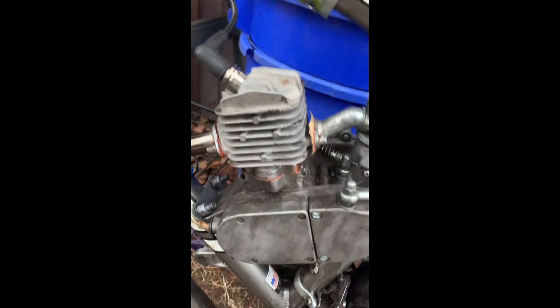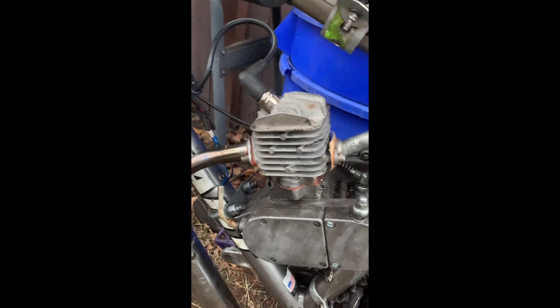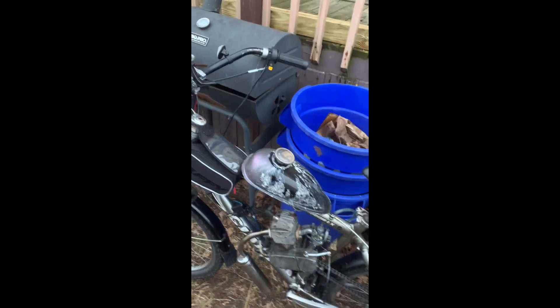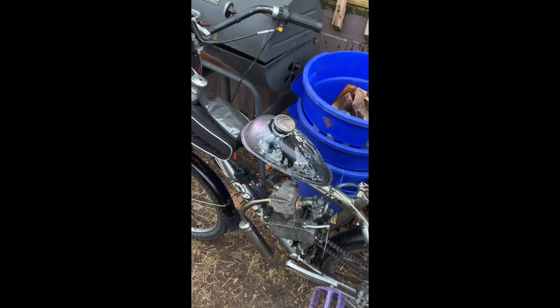We're back. I put my 50cc on the bike — single piece jug. This was my very first motor I ever got. This one is tried and true. I put a new piston in this one about a month after I got it because it got scored up really bad. New rings too because the rings broke. For the first month I had it, the bottom ring was broken and just sitting in the slot — broken in two places, so it was three pieces of a ring — but it still ran great.